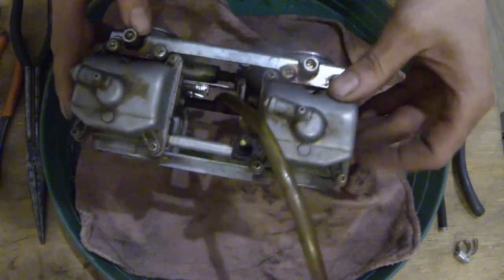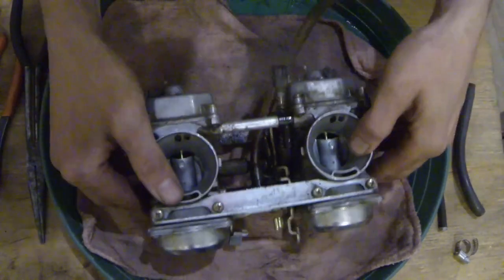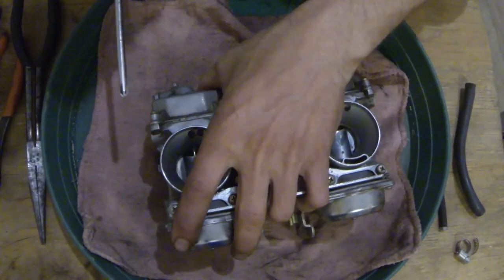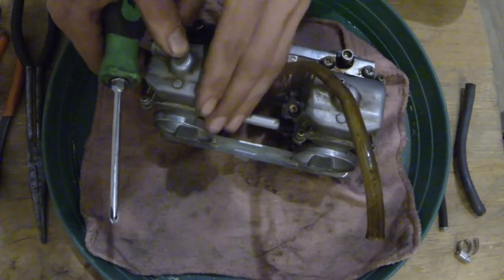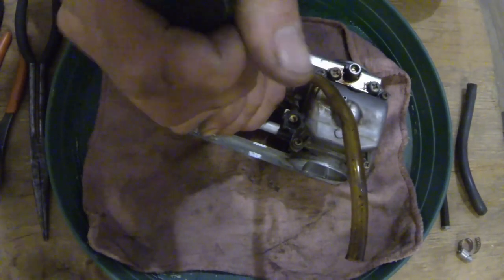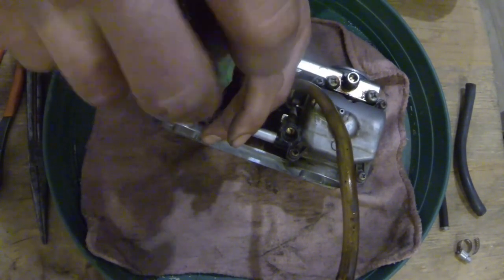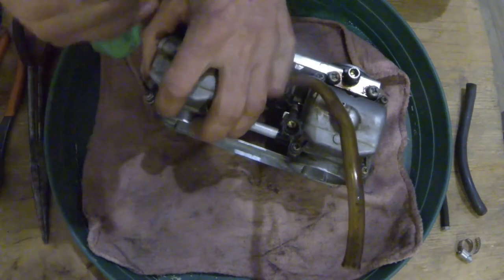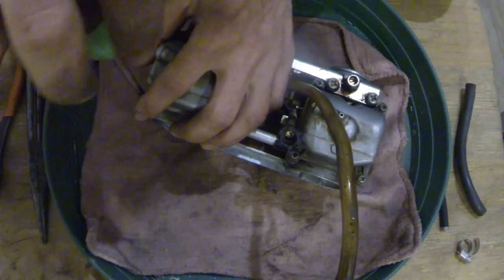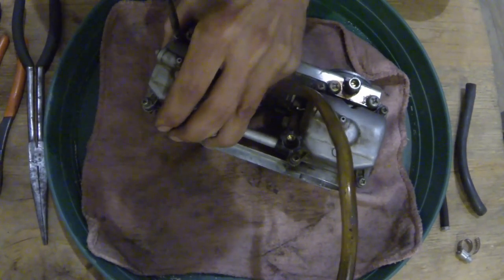What I'm going to do is pull the bowls off of this thing. There's some more gas — bump that out. We're going to start with one side, then we'll go to the other side. I've had these apart about five or six years ago. I did a rebuild on it and then I drove the heck out of it. I'm doing this just to make sure everything is clean — there's probably some old gas that's been in there for four or five years and it might have contaminated these bowls a little bit.